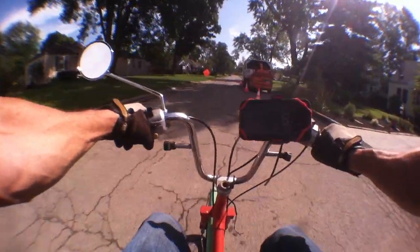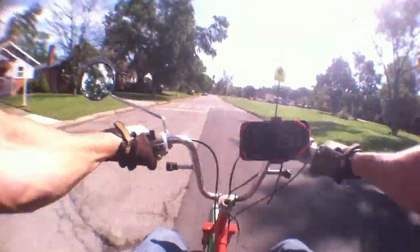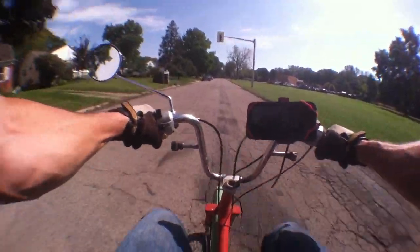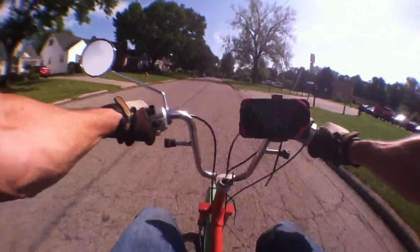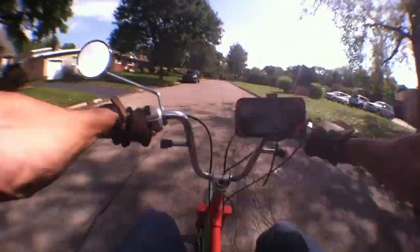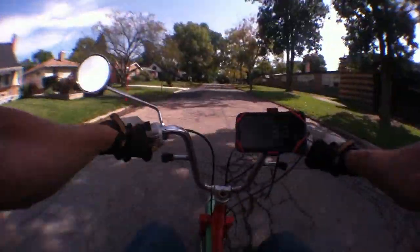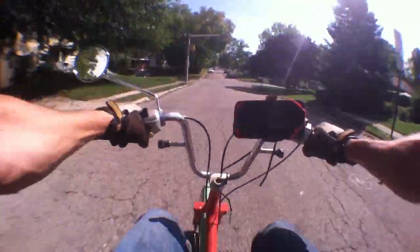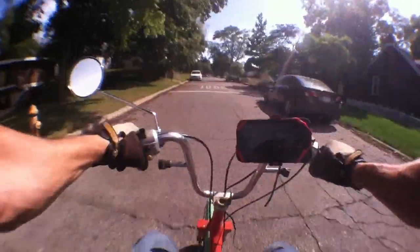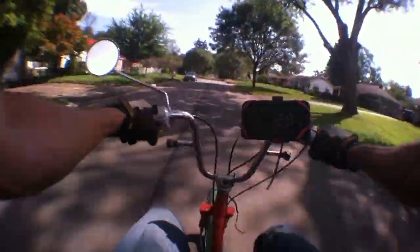And the other thing I changed on this from the first ride to this ride is, I didn't realize it, but I had 78 grams in the variator, and I went down to 39. And I probably dropped down too much because I think it felt faster than low 30s last time. I didn't have a speedometer at the time, but it felt more like 34, 35-ish. So I'm going to go from 39 to low 50s in the variator.